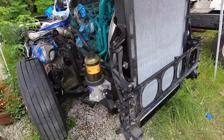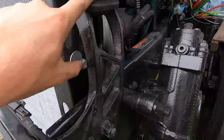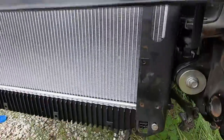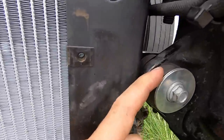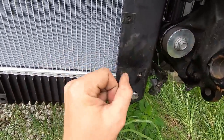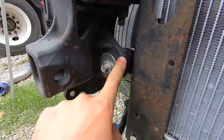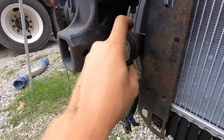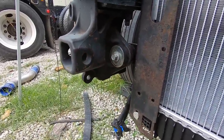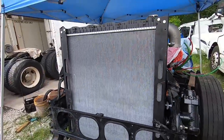That was a little harder than it looked on video, but this thing is all the way in. We have the little rubber bushings right here that handle this side, and on the bottom we also have these mounts. There's a pillow here and it goes between the bracket and a pillow there, so it has a little bit of movement over time so the vibrations don't crack the radiator. I was missing one of these pillows, so I had to go to the dealer — it was $25 for these little bushings. They got me. But it has to be done. I already connected the hoses for the radiator. This thing is solid.